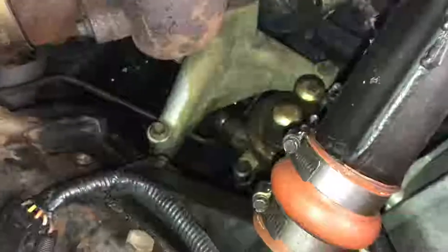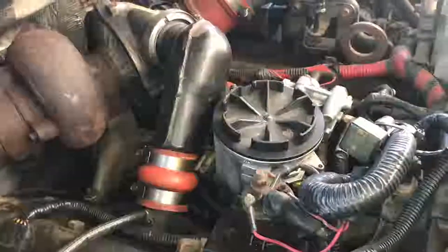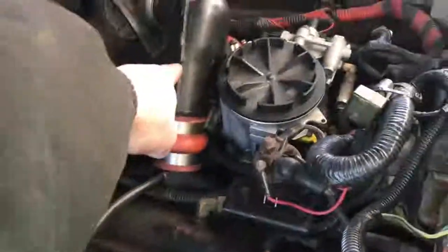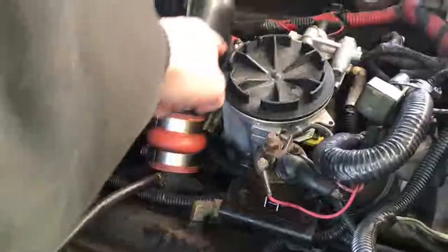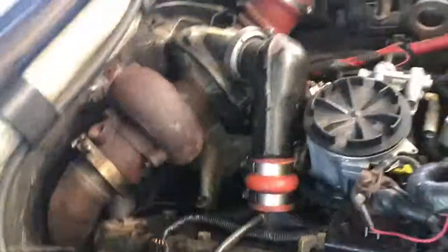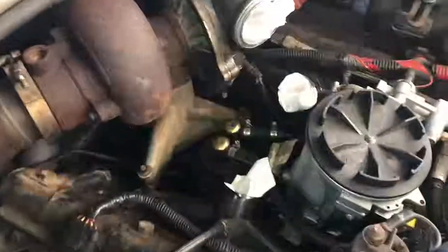Since I know it's actually going to work, I'll start tearing it down and take you along with me. Pretty much what I'm going to start off by doing is getting this Y-pipe removed. Pretty much just a series of band clamps — you got a couple on this side, a couple on that side, and the one up to the turbo. Those are all 5/16ths unless you've replaced them with something else. So I got that Y-pipe off there.